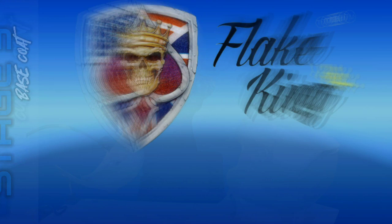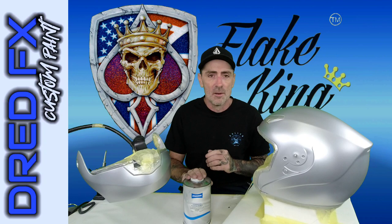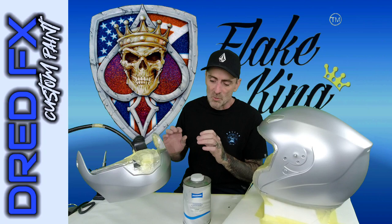There you go. In that last time lapse, you see me drop the base coat down. Before I did the base coat on this piece, I used the Standox plastic primer and gave this two coats, just for belts and braces, because this was a piece of molded white plastic and it hadn't been clear coated. I don't want to just go dropping the base coat down, else it wouldn't adhere to it. So we give it a couple of coats of that.